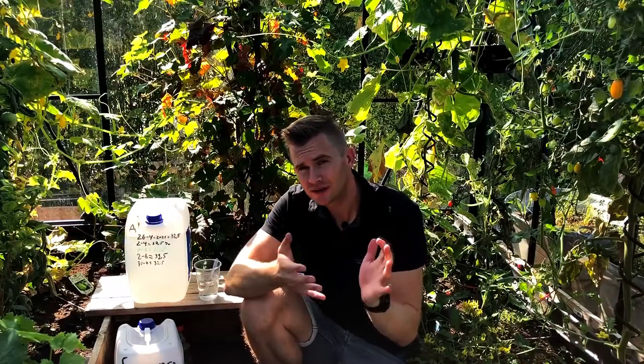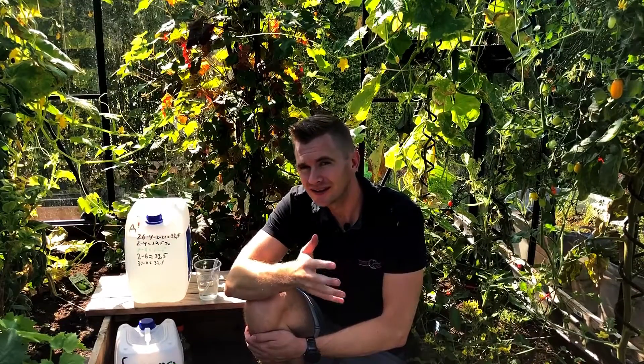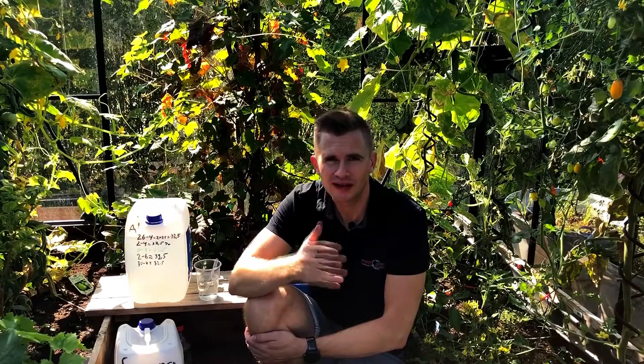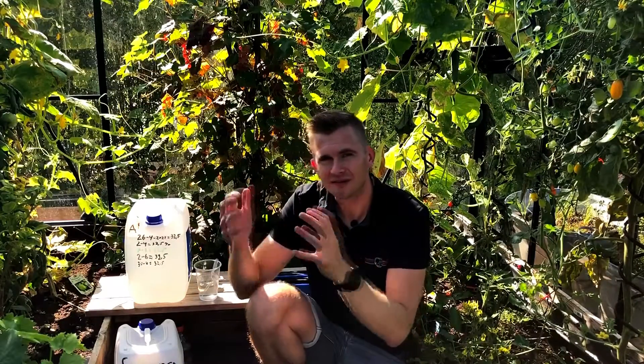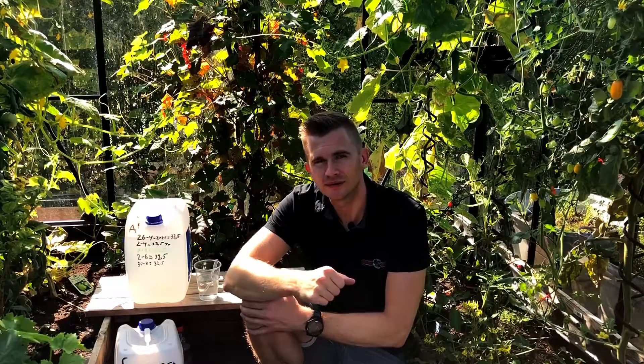This leads me to the conclusion that the next time you have a problem with the AdBlue system that has to do with the AdBlue Fluid, it could be because of the customer — perhaps he or she has filled in washing fluid or water in the tank without telling you. I would empty the tank and fill in new AdBlue Fluid, and also check the filling cap or anywhere else that could cause water to enter the AdBlue tank. Most importantly, explain the importance of this to the customer so they don't fill it up with washing fluid or water in the future.